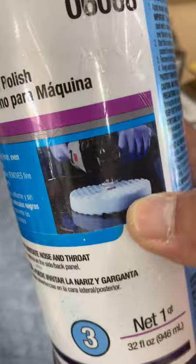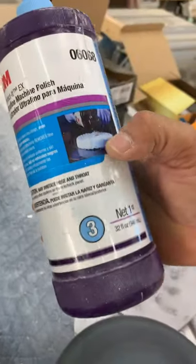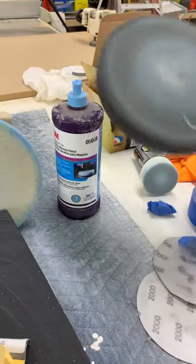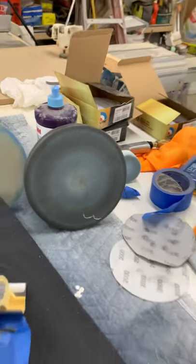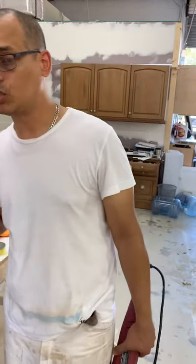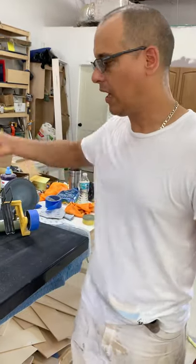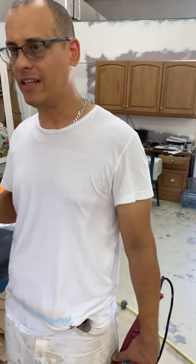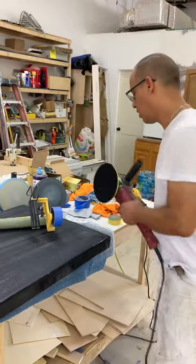The 3M product is for the third/finish step, but I'm using the black pad from Harbor Freight with the blue compound since I didn't buy a separate product for that. Once you do the 1000, 2000, and 3000 grit with water, make sure your wood — in this case MDF — is sealed. You don't have to spray a lot of water, just a few drops — it'll keep the sander from getting too hot or burning into the clear coat and helps it run smooth.